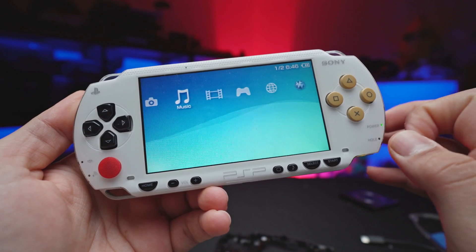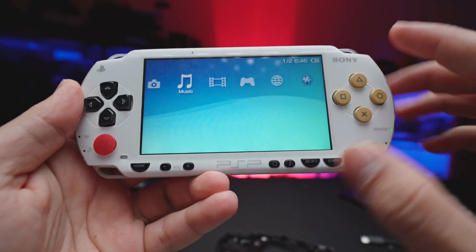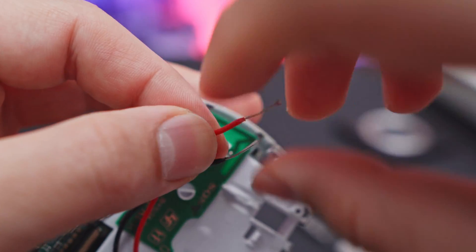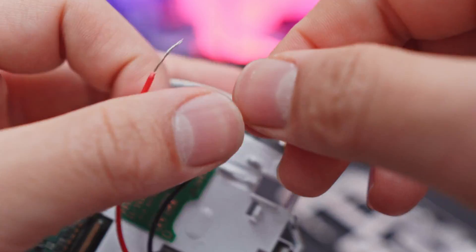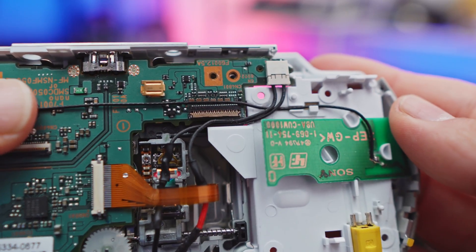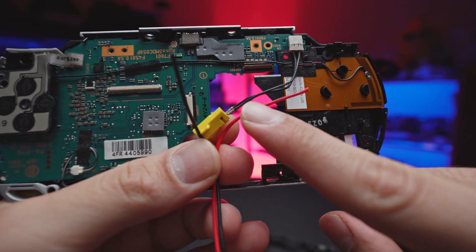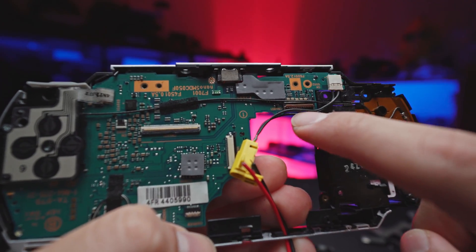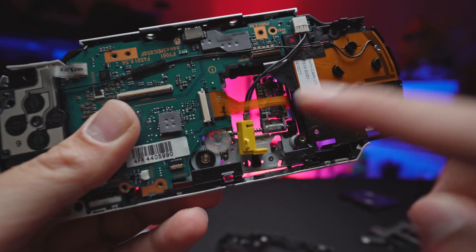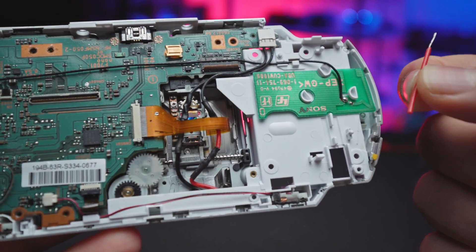I need to make sure this method works exactly as intended without interfering with basic function, so I used original faceplate and buttons to verify everything works as expected. Strip the wires on both the original charging port and the Type-C port. Plug it in and try to get a good idea of how it's going to sit, as it will route through the trimmed area. Figure out exactly how much wire you need, making sure it's routed smoothly with enough slack that the connection routes comfortably between the ribbon cable without interfering with its mechanics. Give yourself more slack than you think you need.